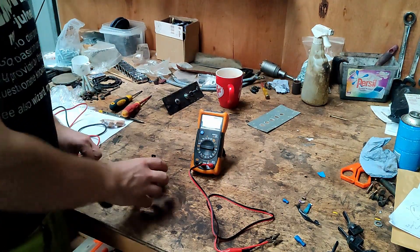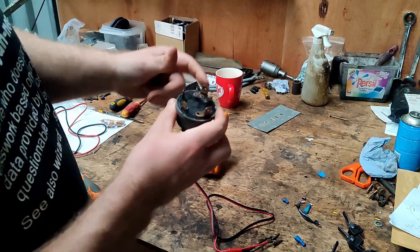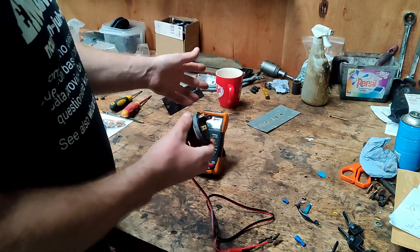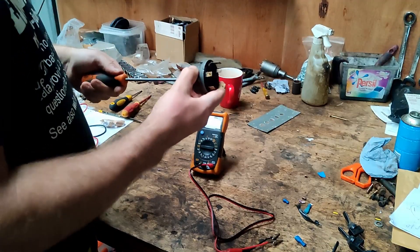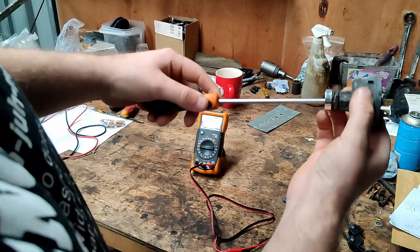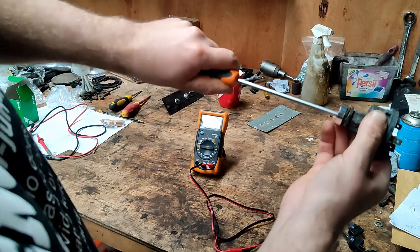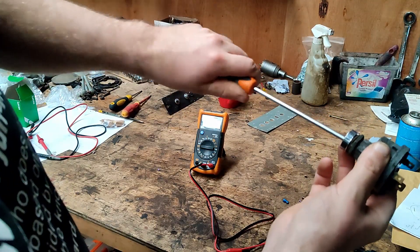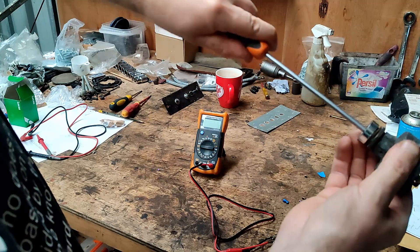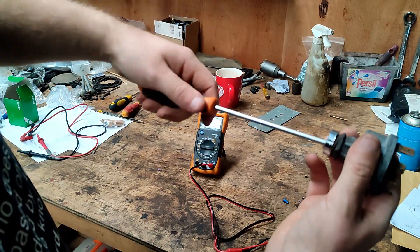Carrying on from testing switches, I've got my old ignition switch here — I've replaced this on mine — but we can use it to not only test it, but also if you're not sure which terminal goes where, we can use our ohmmeter to test it. These switches have four positions: all the way counterclockwise is off, one click is ignition on, the next turn is heater plugs on, and then turn it more and that is starting. It's spring loaded back, but on the heater plugs the spring isn't that strong, and that could lead to you accidentally leaving it on.